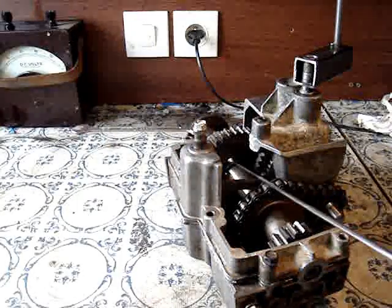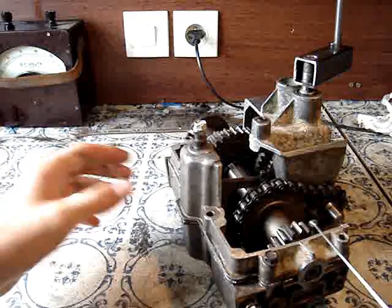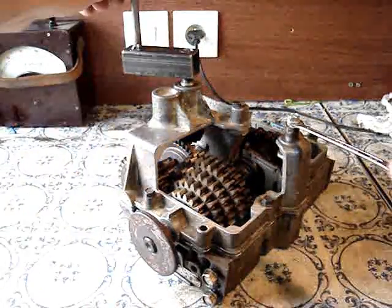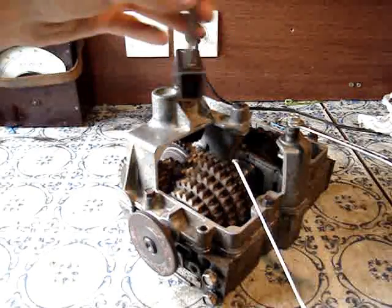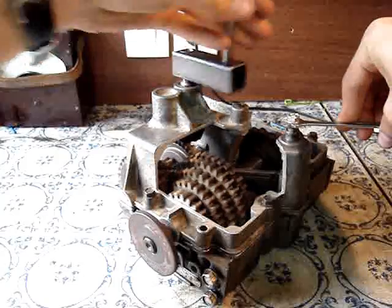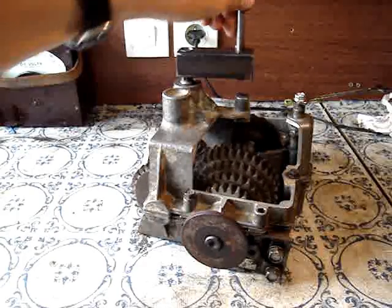Down there with a little hole, on this shaft is the select bar which slides in and out on the gears, which I'll explain at the end of this video in a simplified version. So now in first gear, it's connected that one gear there to the output shaft, so now it's turning the first gear. I'll go right over to the top gear, which is now connected that one gear there to that drive shaft.